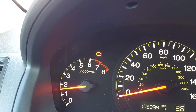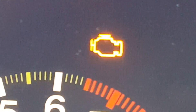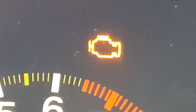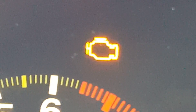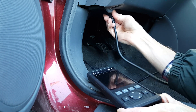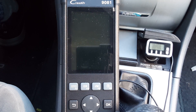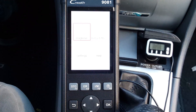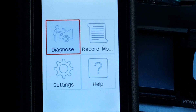Let's take this out to the car. We're looking at a 2003 Honda Accord — its check engine light has been on for quite some time. I have a fair idea of what's going on; this car has a considerable oil consumption problem but it doesn't smoke. I thought this would be a good candidate to see what this OBD2 reader would reveal. The data port on this car is under the left edge of the dashboard, right about here. Once we plug it in, it powers on. I'm going to go ahead and turn the ignition key on so it can read and communicate with the computer.